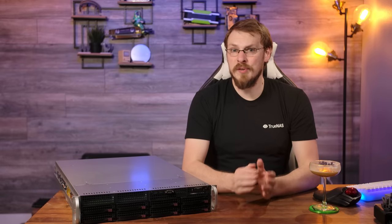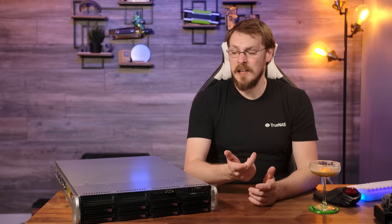Something worth noting for high-speed storage users: because this is a dual socket server, PCI resources are wired to one CPU or the other, potentially creating NUMA-related latency depending on your use case. In this server, all five NVMe slots — the single M.2 plus both JNVMe ports — are wired to CPU 1, as is the Intel X550 10 gigabit LAN controller. CPU 2 has little connected beyond PCIe ports 4 through 6 and required chipset lanes, so most of the I/O flows through CPU 1.